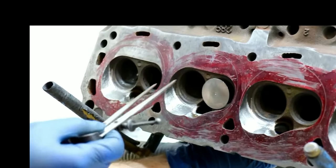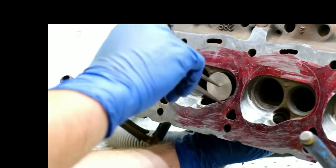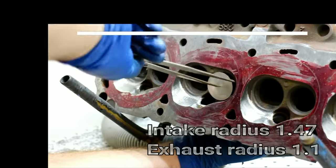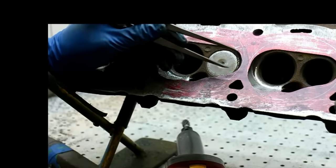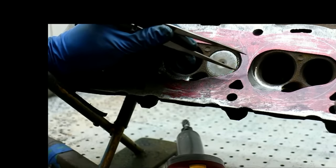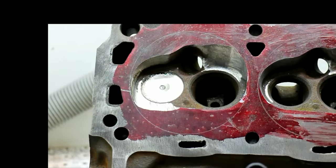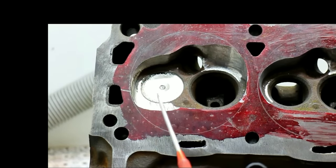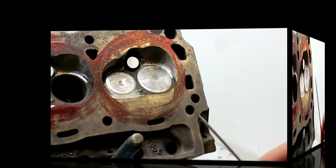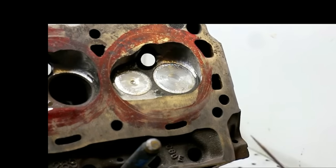This is the technique I now use to help deshroud the valves the proper amount. All you need to know is the proper settings for your caliper for the intake and exhaust. Pay attention to your gasket line — you don't want to go over it or you will be compromising the integrity of the head gasket. This mod that you see here is learned at DV's Porting School. If you copy this cut into the chamber as you see here, it's worth a solid 10 horsepower even on your basic small block Ford. There is one area you should not grind on right here — it will kill airflow and not be helpful whatsoever.